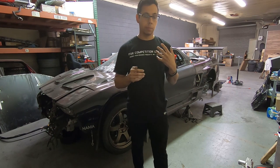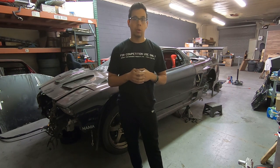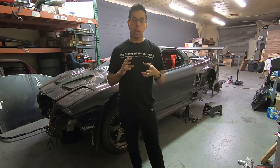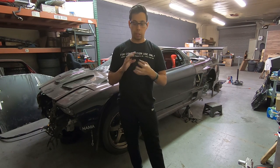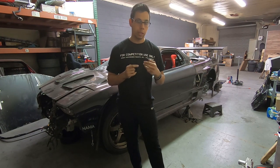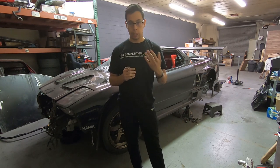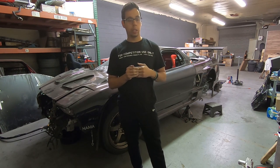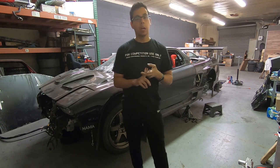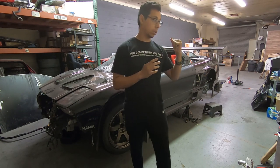The biggest difference between a Dogbox and a standard transmission is the engagement. So your typical car has a synchromesh transmission. And the synchro essentially lines up the gears. It's a separate component on the gear that lines up the teeth and meshes it together in a very smooth and slow way so that you can smoothly change gears, which is nice for a street car. However, on a race car where you want to change gears as fast as you can and have it as reliable as possible, the dog engagement does not have a synchro, and it has 5 dogs on the Samsonas setup.